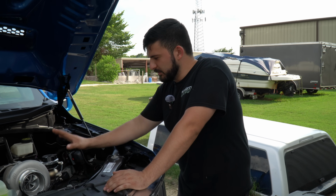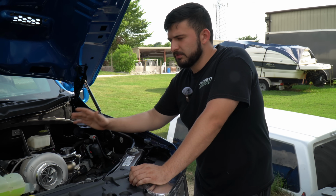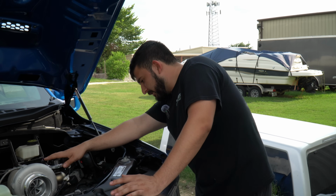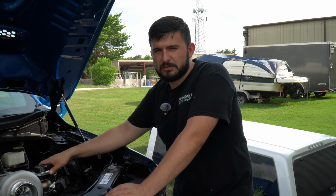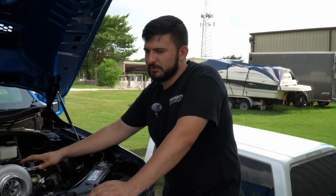With the same gates, same spring on the gates, we're gonna swap turbos, put it back on the dyno, and compare the previous pulls versus the pulls on those turbos, which are bigger, which should make more power. Other than that, we've had pretty good luck on the setup. We weren't planning on testing anything on 93 really, but since it's been working, we're like, man, let's push it, let's see how far we can get. So we're just gonna put it on gate and then put a fuel system on it.